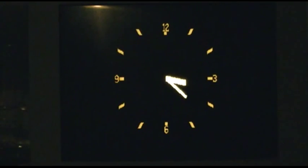The little blip you saw in the upper right corner was the RAM drive being accessed. It displays one of four characters up there. And here you can get an idea of what SimCGA does. The actual hands of the clock, the hour and minute hands, as you see just updated, are in white if you were seeing this on a CGA display, so they appear the brightest. The second hand, I forget exactly what color it is, but it is different from the actual numbers going around the clock, and you can see that the little lines that make up all of those numbers and that second hand are basically stepped. Cyan will be in one particular configuration, and magenta will be one pixel offset from that to give you some distinction if you happen to have graphics that intermingle the two.